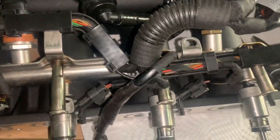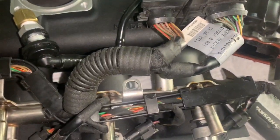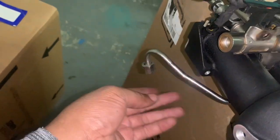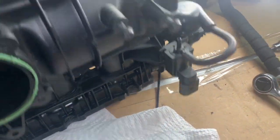Now the next thing I'm going to do is put the fuel line back on — this fuel line bolts up right over here. When you're putting on this fuel line, you want to go through this first tube and come out right here, because this is the part that goes back to the fuel pump. Just slide it through, put it on, and that handles the main part. I officially have the fuel line on — there's really nothing else I need from the OEM intake manifold.